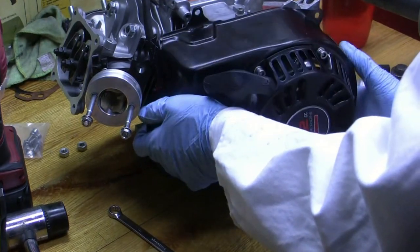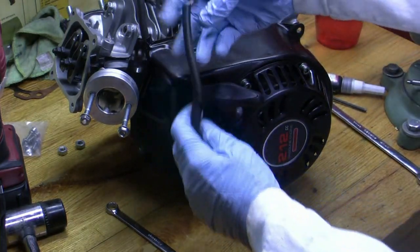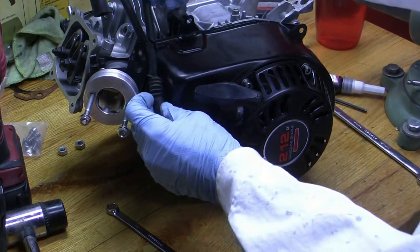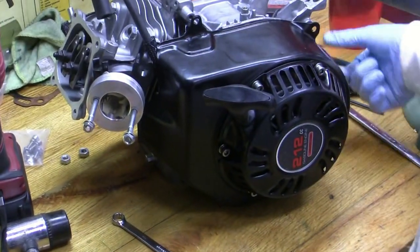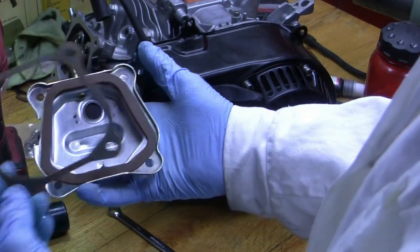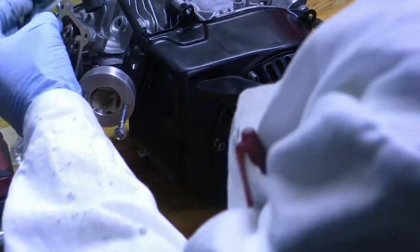I noticed — which I believe is probably what happened to this thing here — I think he ran the sucker up through the side like that and it got cut in there. That's how this Honda one got a little messed up. Make sure when you put the valve cover on, you put a new gasket on. Here's a different type of gasket right there, and here's another kind — that has like the notch out over the nuts. So I'm going to go with this kind. I bought a couple gaskets; you've got to put a new one on unless you want oil leaking all over.